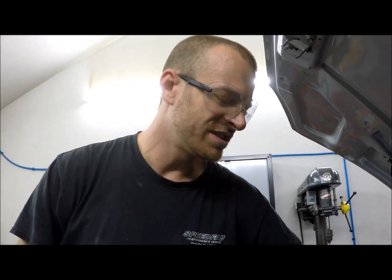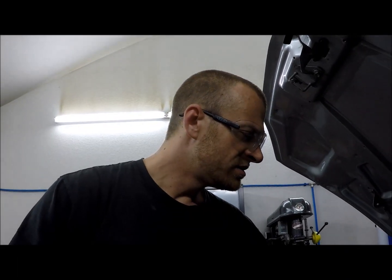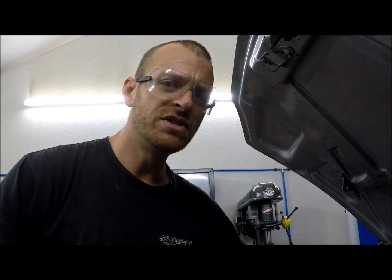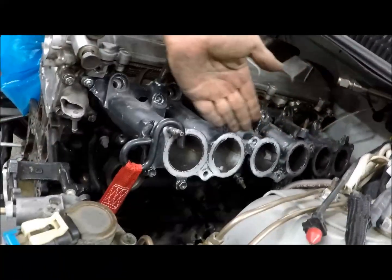Really towards everywhere that's in the engine bay is a little bit snug, and these are fairly long runners. They're trying to, I think, get some torque out of it in the NA motors. So we're going to shorten the runners about 1.5 inches, and then we're going to CNC out a piece of 1/4 inch plate. So there'll be a single piece of flat plate that'll run where we trim this out.